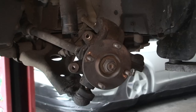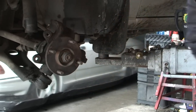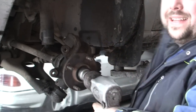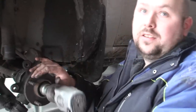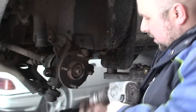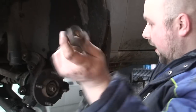What we need to do now is take off the big nut in the middle - 32mm socket. By the way, this is a 99 Fiesta, forgot to mention that. Now that's taken out the nut - you get a new one of them with the kit. So now we can actually take out the drive.